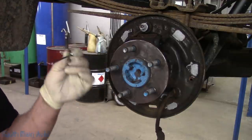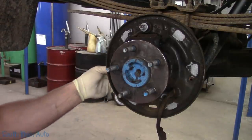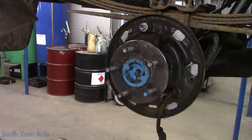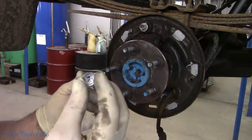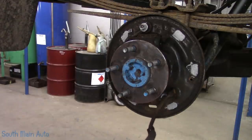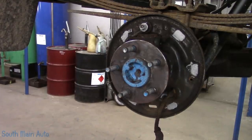We will take a nail. Make sure they're the same size as your old nails, or at least the size for the vehicle. I hate comparing stuff to the old stuff if I know it's not original, which these rear brakes are not. We're gonna take a spring and a cup, and then, man, I'm getting ahead of myself. Gonna make a mistake.